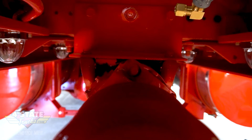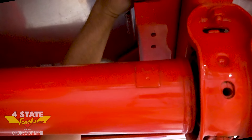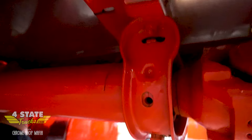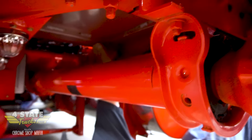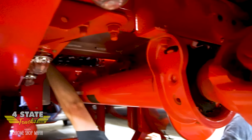There's the big piece — it's set in place. Now I just need to go underneath and bolt this up through the bottom of the cross members. There are channels welded in across various places with nutserts in there, so all I have to do is bolt it right from the bottom. For now I'm going to loosely bolt this into place, as I've got more stuff to line up in the back and it's a little more critical on the fitment.